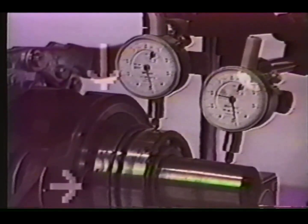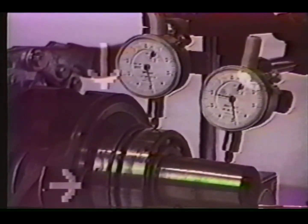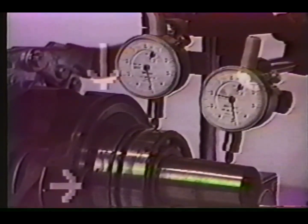Whenever you are straightening a multi-cylinder crankshaft, you should always start on the PTO side and work your way toward the magneto side, straightening 1 crank rod pin at a time. The dial indicator position in relation to the rod pin tells what action is required to straighten the shaft.